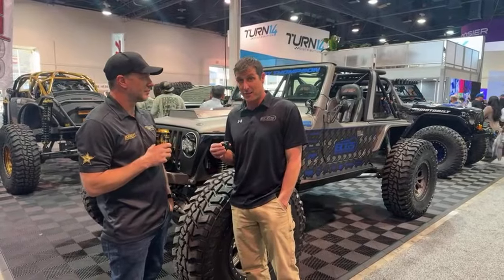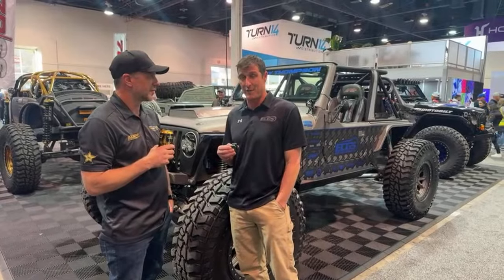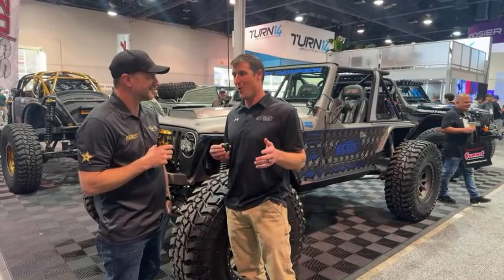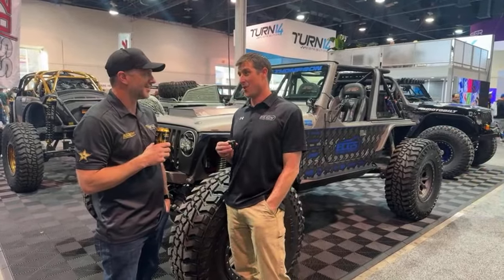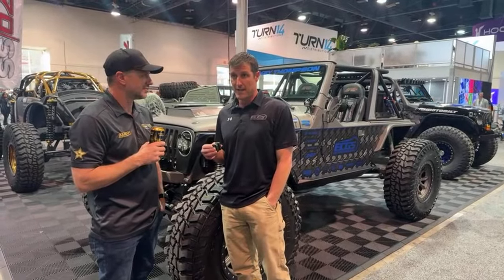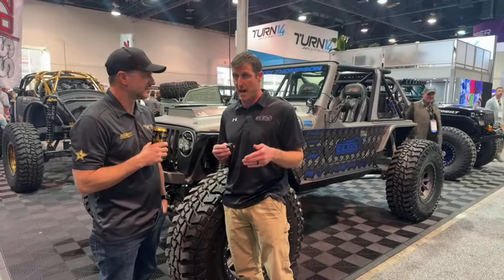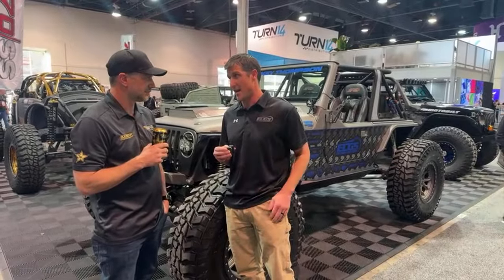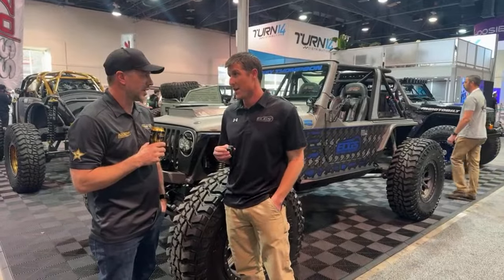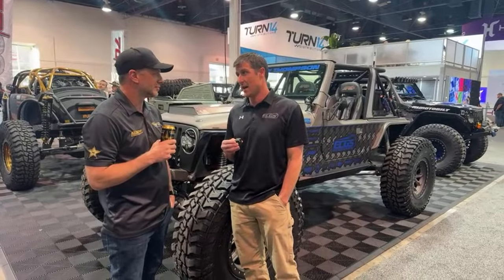So, your stock 14 bolt, a lot of guys will bend spindles. A lot of buggies with stock 14 bolts, we'll sell them chromoly shafts, and when we do, they're like, it won't go in. I'm like, yeah, your spindle's bent. Yeah. And so we came out with the 40 spline kit. A lot of stuff in the market is very expensive when you get into 40 spline, but everything we did is very high production, high run, highly engineered, highly designed to be economical and essentially unbreakable. Gotcha. We've yet to lose a 40 spline rear shaft. We've been selling them for 8 years.